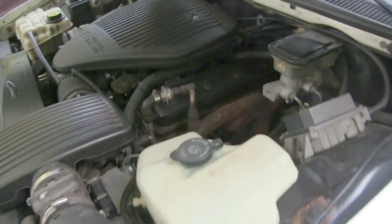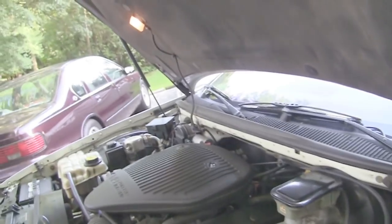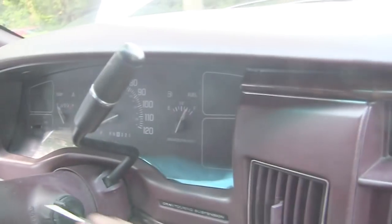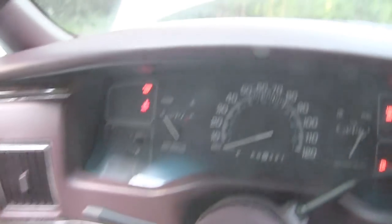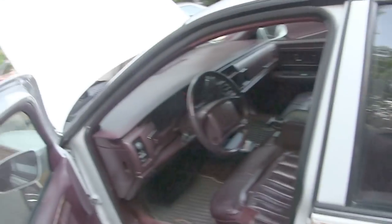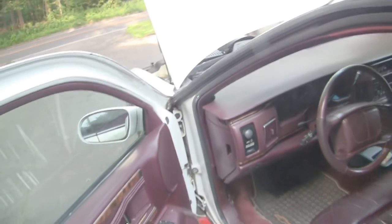Things are pretty clean under the hood. Whoever originally owned it probably took really good care of it. I don't know why the heat shield's falling off the exhaust manifold. Other than the transmission, the only other issue I'm seeing - let me start it up - you can see the PASSKEY light stays on, I don't know what's up with that. It runs pretty nice though. I drove it home at 3,500 RPM at 60 miles an hour - yeah, it's slipping pretty good in fourth gear. That was real fun.